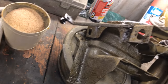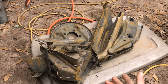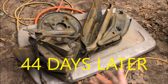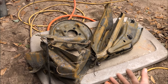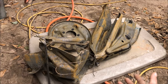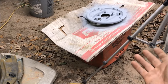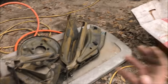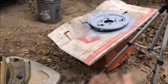I want to explain this so you don't think you're going to do molasses rust removal and go straight to paint. These parts have been in since December 11th-13th and it's now January 25th. We've taken them out and washed them with water, and you can see there's a big residual of whatever is going on and they're already starting to rust again. It's a whole other process to get this residue off. The only options I've found are putting them in acid or sandblasting them.